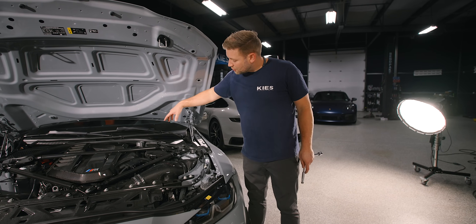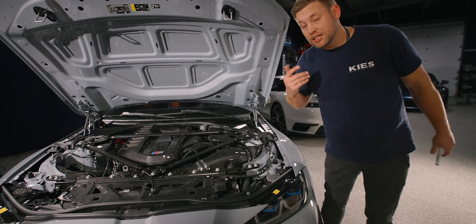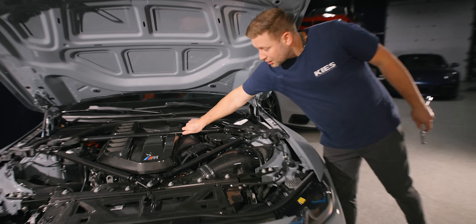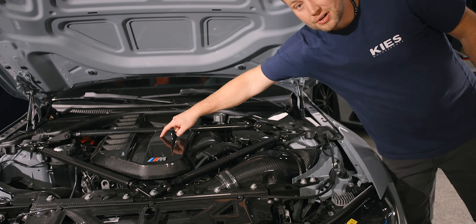Next, what we need to do is work with the fuel line. The fuel line is basically over here to back here. To make it a little bit easier, I'm going to remove the strut brace — just this cross part over here. It's held in with these four 15 millimeter nuts, and then remove your engine cover.